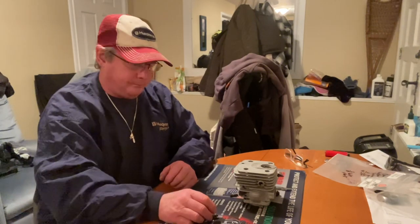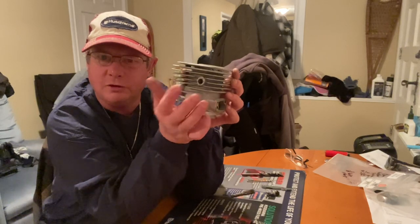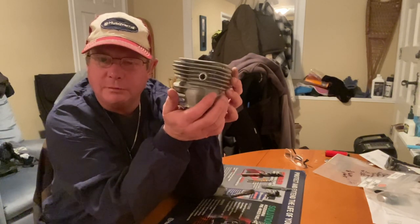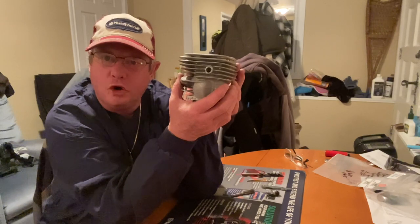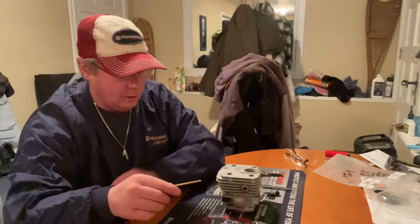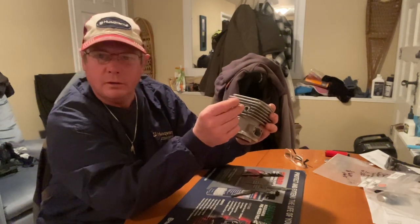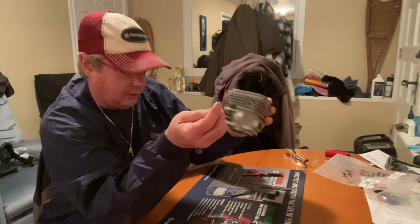What you need to do, if you've got this type of 288 cylinder with that blank boss spot: first, I center-punched it with a center punch. Then I drilled a one-eighth inch hole — brand new drill bits so I knew they were good. I drilled the hole right through the nicasil. I knew when I hit the nicasil because it was harder to get through — that's why you want good new drill bits. Then I measured the depth of that hole I drilled.